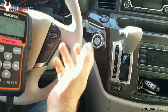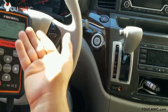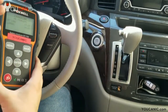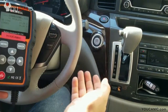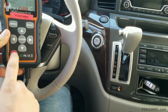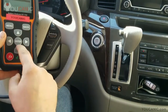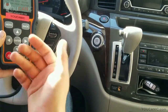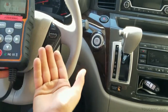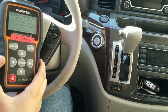Once you follow all the steps — let the engine idle, rev it up, let it idle again with headlights or blower fan and rear defrost on, then rev it up — you'll have results. It'll say no problems, or there's an issue with the alternator, or it could also be the voltage regulator in many cases. As you can see, it's very easy to use. It also has a nice feature — a Bluetooth printer built in. So if you have a Bluetooth printer, you can print the results, enter information about the car, and send it right to the printer. That's great for a shop and great for DIY as well. It's so easy to use, a lot easier and less confusing than a multimeter. Thanks for watching.